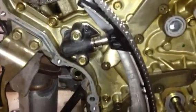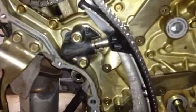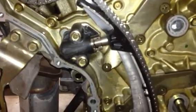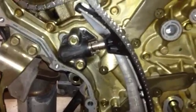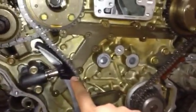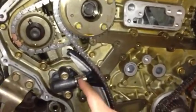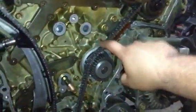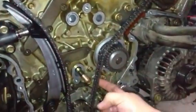So I pulled the motor out, took off the cover. You can watch the video right before this one to see what happened. But this one's all done and ready to go. It has a new tensioner and a new guide. As you can see, the guide is now up against the tensioner, nice and snug with no slack anywhere — it's nice and tight.